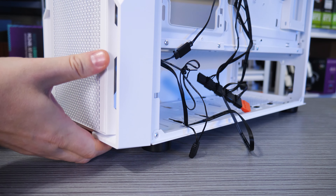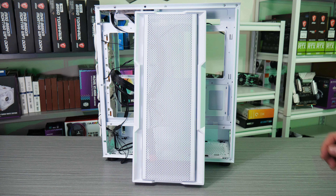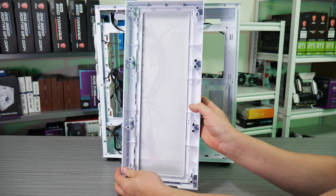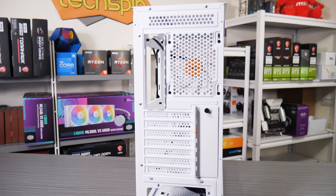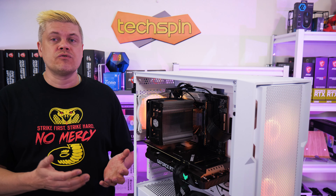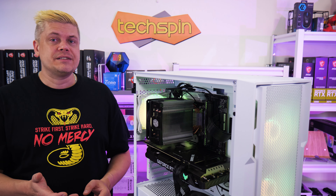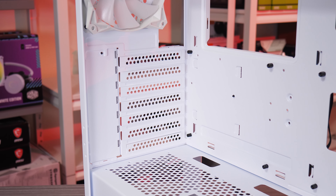Setting the glass to the side for safety, we took off the front by pulling from the bottom — it's a bit harder than normal to remove. The double mesh pattern inside the front should filter out dust fairly well, however there are five small openings either side with absolutely no filter. There's no wiring attaching to the case front, which is great. The case rear has seven PCIe slots, however they have these lazy stamped bend-off type covers which should be screw-removable covers instead. The biggest problem is that they require you to remove your motherboard completely — otherwise you'll scrape components off your motherboard if you try with it still installed. Remove these immediately.